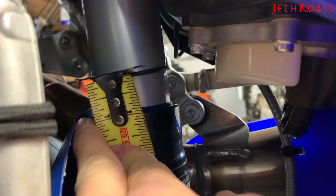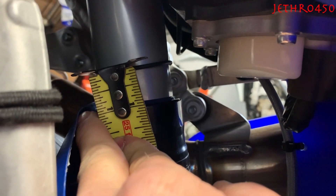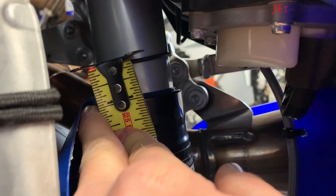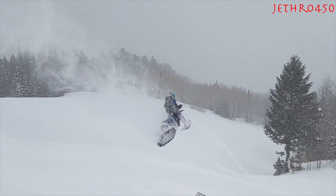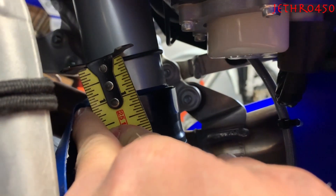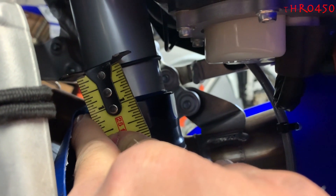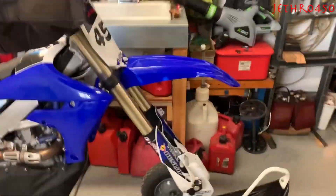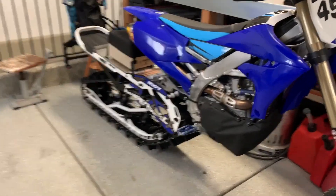One more thing with the X-Tune on my TSS: at almost 400 PSI of pressure, I'm not getting quite an inch of movement, and I'm going to leave it that way — the more that thing moves the worse performance you'll get in powder. I really only have the TSS for jumping. I'm 160 pounds, 400 PSI, and that amount of movement on the TSS is perfect for me.